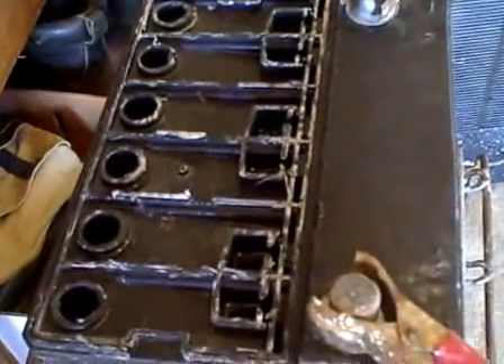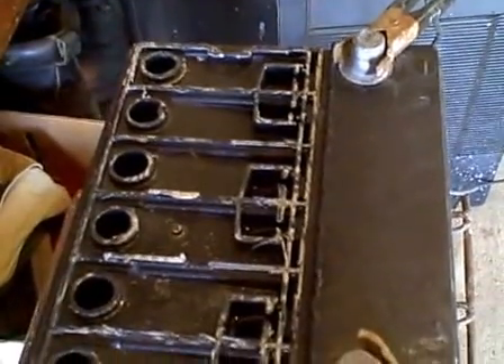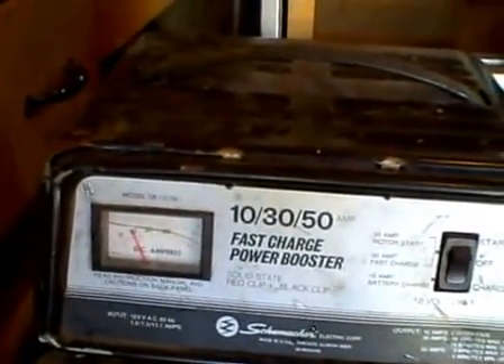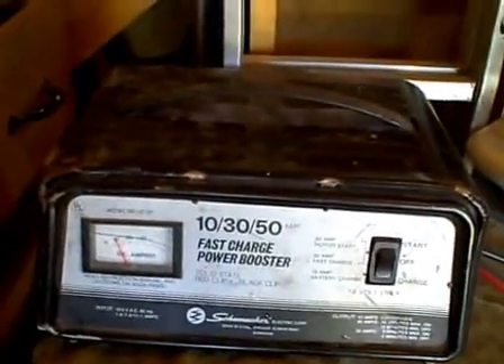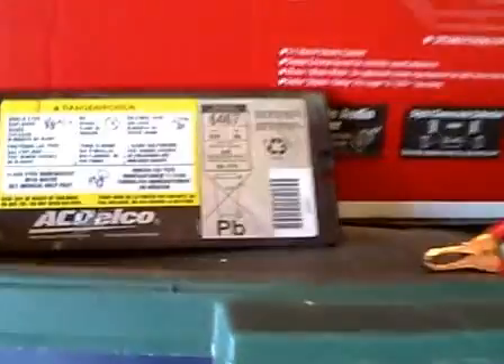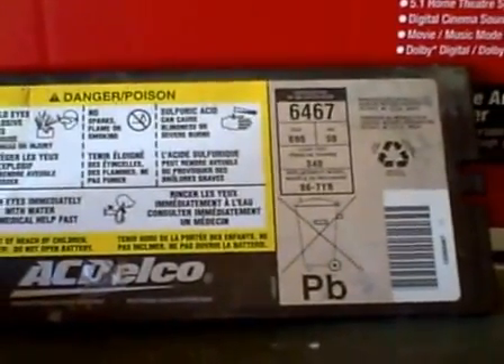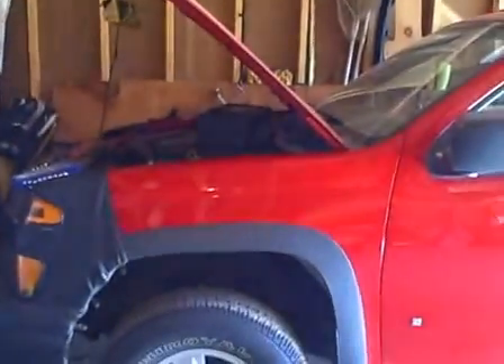This was last night, so today here's the battery. You might be able to hear it — it's percolating a little bit but that's okay. If you look at the battery charger it still shows about a 10 amp charge going to it. This battery is really bad. If you look at the side of the battery you can see it's swollen. This battery is the original ACDelco battery from 2006 out of my mom's Chevy Colorado, which is right here with the hood up. Kind of hard to see but there's where the battery goes.